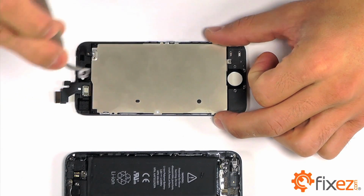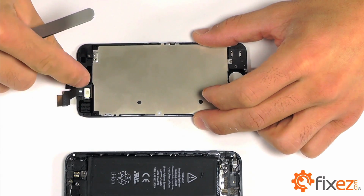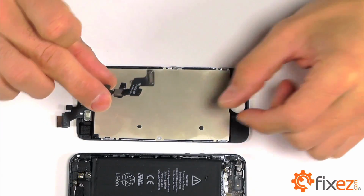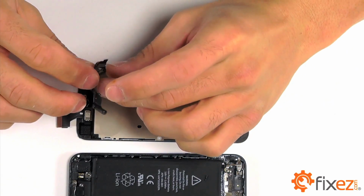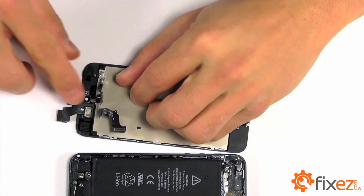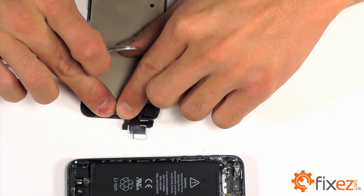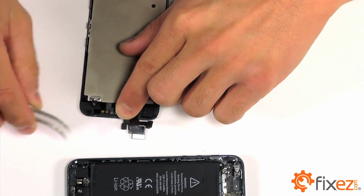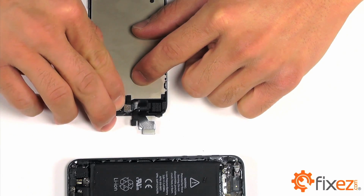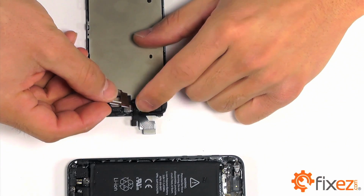Let's begin with our front-facing camera assembly, first with the clear housing put into place. We can now settle in our front-facing camera assembly. Followed by our earpiece speaker, and its back plate, which we will secure with the 2 Phillips screws.